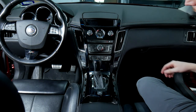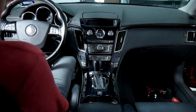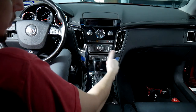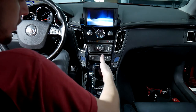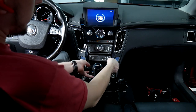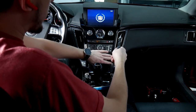The next step we're going to have to move the shifter back, so we're going to have to turn on the vehicle. You don't want to turn it fully on — just enough that the ignition or the accessory is on. Then we'll shift back, pull the shifter up, turn that sideways, and then this whole trim comes off on the bottom.